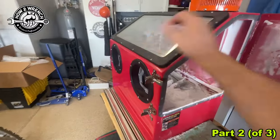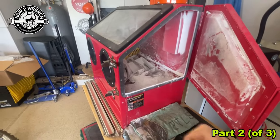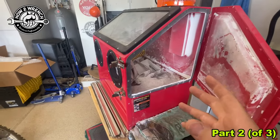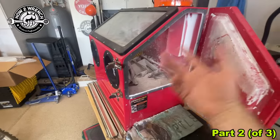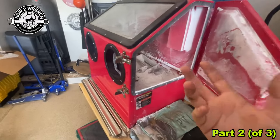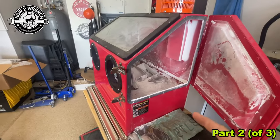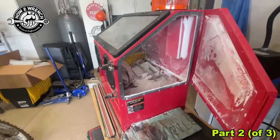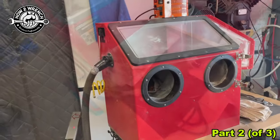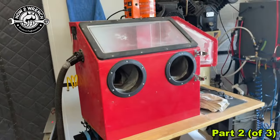There's an intake of air that has to come into this machine; otherwise it'll compress. So if you have this blocked or plugged, it'll pull the windshield down. I find this really cool sweet spot where I'm blowing the soda dust all over the place and then I'm using the vacuum. But if you have the vacuum wide open, it's literally just taking everything out of the cabinet — you'll empty your basin. So we need to control it.